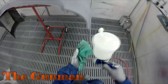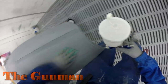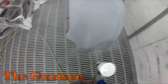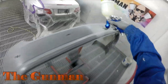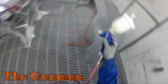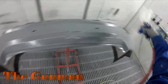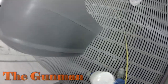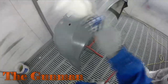The product I'm using first up is DuPont's 222S. Technically it's used as an adhesion promoter — I worked with this stuff over 10 years ago and we used it on just about anything. You can use it as a blending aid instead of your base coat blender, you can put it over silvers to blend, use it as an adhesion promoter, and also as a transparent sealer, which is the main reason I'm using it here. We didn't have any other specific transparent sealers at this shop, so I made do, and as it turns out it worked an absolute charm.